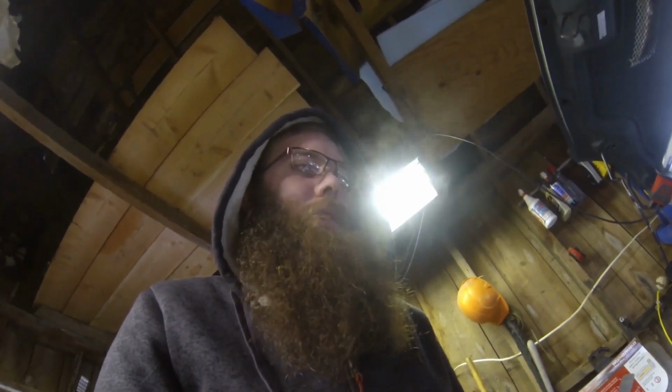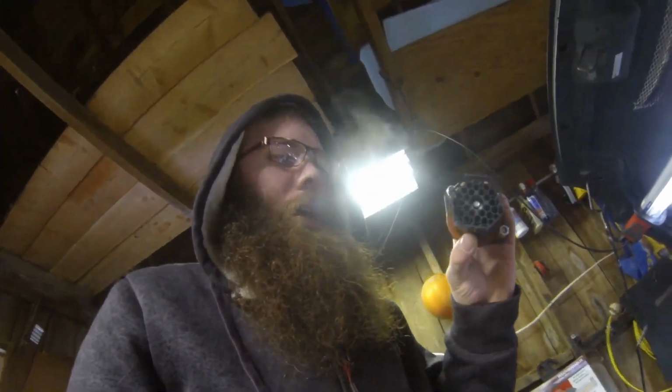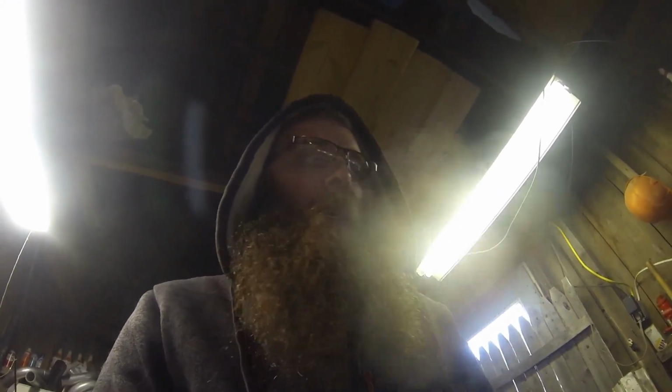So I'm not in there trying to cut stuff or run a wire through the car or deep in a connector and feed everything through so I can work with it. So I was going to use this connector here. I got this connector off of Amazon, and I got the hole cut and I had it mounted. It was in a good spot. It cleared a lot of stuff. Started pinning the connectors with the terminals, and every terminal that I would crimp, it was trying to bend and it would never sit in the connector right. The ones that I did get to work, I put the connector body together, pulled the connector apart to test everything, and the pins were sticking. It was pulling wires through the connector, and it was just a big piece of junk.